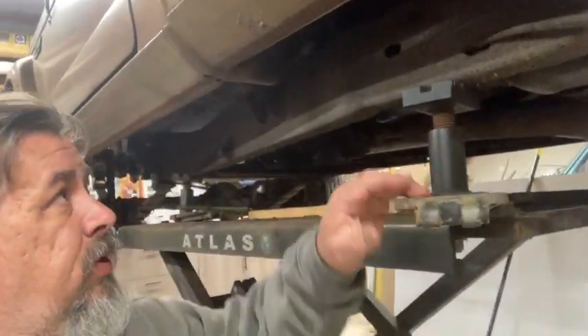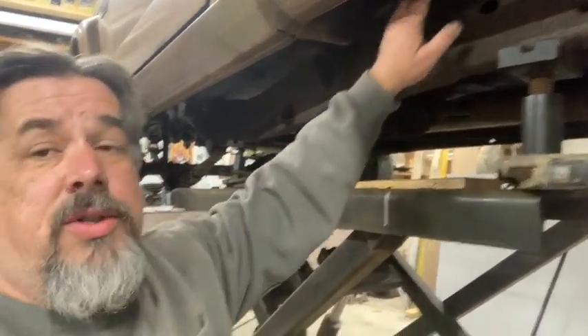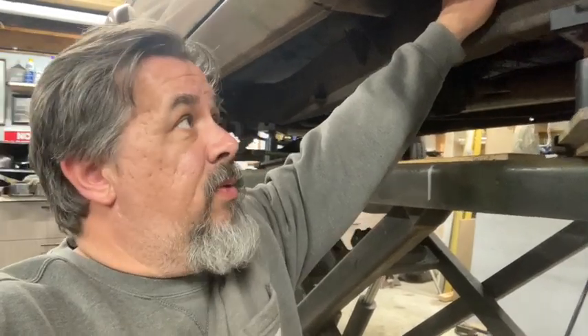Eventually we'll put the full good frame on this truck, maybe — who knows. Some guys say you can't weld a frame, but I've welded a lot of frames on trucks. I've fixed stuff that was broken in half and I'm not scared to. What we'll do is cut her on an angle — just like how we used to do it when we would stretch truck frames — then fish-plate it on the inside. That's how Ford always recommended doing it.